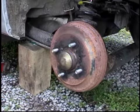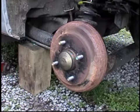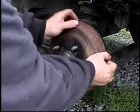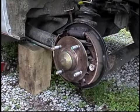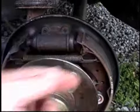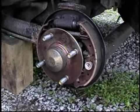Hello everyone, today I'm going to go ahead and change the wheel cylinder. I figured I'd make a video about it — it's not really complicated. Usually the biggest challenge is getting the drum off, but I just had it off and right there you can see that little piston is leaking down onto the shoe, so I figured I'd change it.